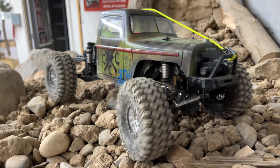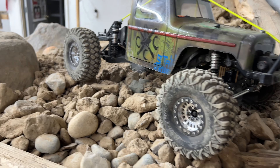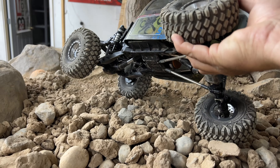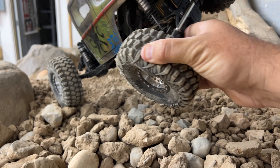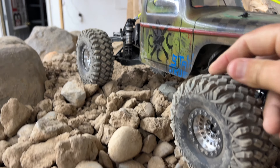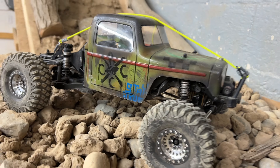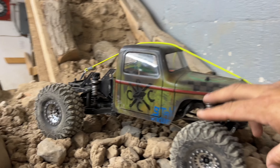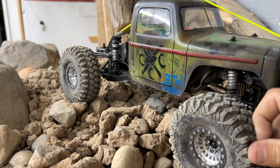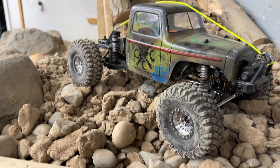Definitely can feel the steering improvement with the on-axle steering. Lots of instant power. Feels like it flexes decent with the link risers in the rear. I'm just not sure I'm sold on these yet — we might have to sauce them up and see if they're any better. They seem slick to me, and with these big lugs they still don't seem to be gripping in and pulling forward — they just push and slide a lot.